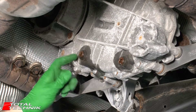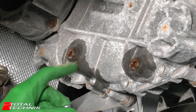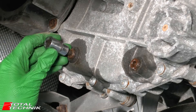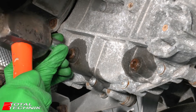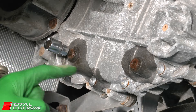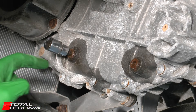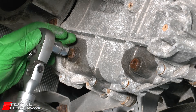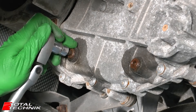These plugs usually have a hex head on them - on this Audi Q7 here they're 8mm. Another tip: if yours have got a little bit of corrosion in them and when you put the hex bit in you can feel some resistance, give it a light tap to make sure that bit goes into the end of that plug as deep as possible. If you do have corrosion in there, the last thing you want is for it to round off when you start turning it, so by ensuring that the bit is in as deep as possible you're minimizing the possibility of that happening. These are only torqued up to around 20 Nm, so even with a little bit of scum built up around the sides these shouldn't be that tight.